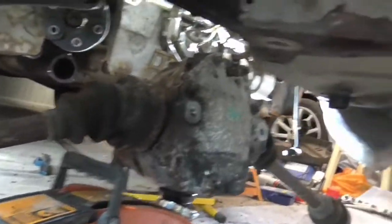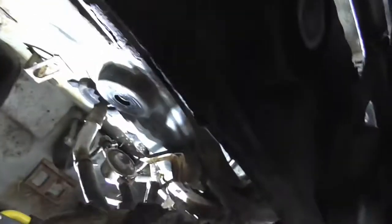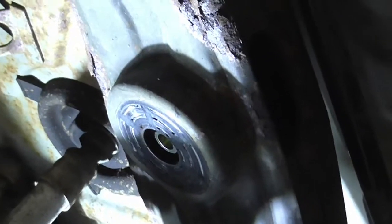The diff is out with its drive shafts — just lowered it on the trolley jack. There are two bolts at the back — you can see one there, the other one's the one you can hardly see, accessed through the boot, and this one you can get to directly. There's one at the front which goes into there; it had a captive nut in the top that was spinning. On the back of the beam there's a cut-out where you can get a socket in — I managed to get a 17mm socket on the end of a slim socket holder, got it in through the top, held it, and undid it. And down she came.